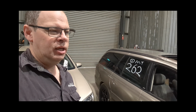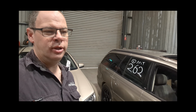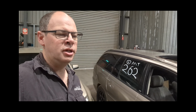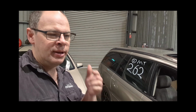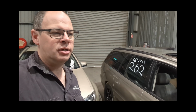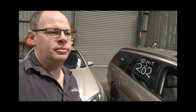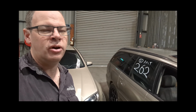So I was finding with the nitrous, we had 400 and with a 100 shot of gas, we had 436 horsepower at the rear wheels, and what we're finding is that it would peak early and fall over, and that'll be a mixture thing, but we were running that with open pipe, so I was tuning more off the plugs rather than an air fuel ratio. So I'll get an exhaust on it, or some pipe extensions, so we can get a decent AFR reading, and then play with the tune so it doesn't go rich after that initial hit. So it gets the initial hit, all looks not too bad, and then it richens itself up, which kills the power a bit. So if we can maintain that power out to 6,000 RPM instead of it falling off by, you know, the low fives anyway.